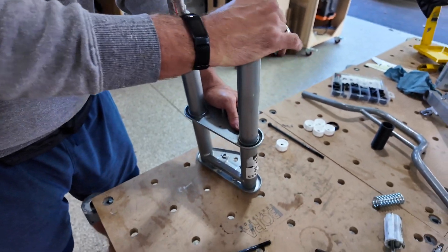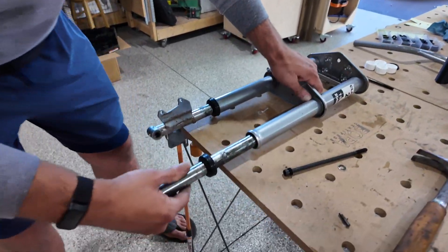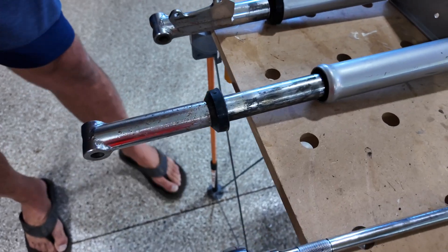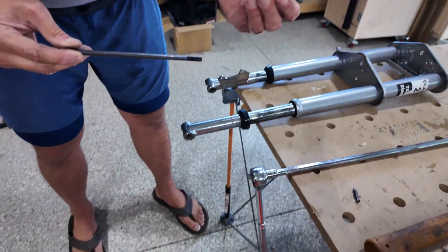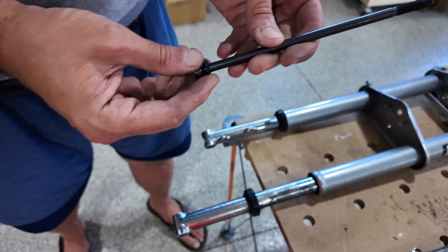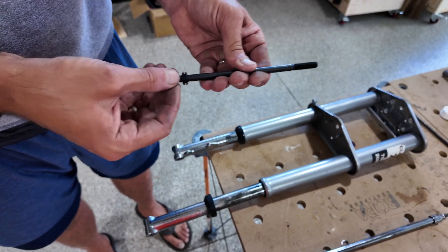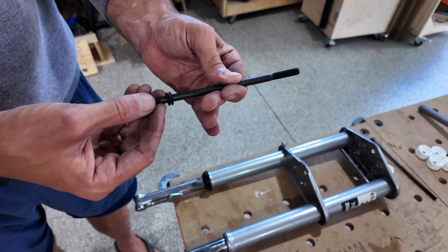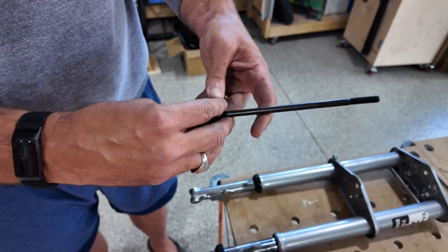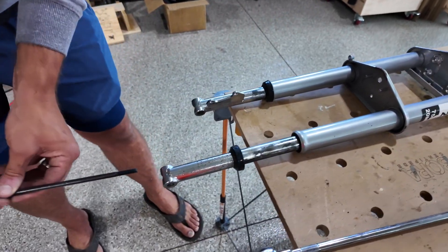Now that the upper fork is loaded, our last step is to put the lower piece in — it should slide right inside and you can already see it's quite a bit longer. We'll compress it slightly as we feed it in. I've added a little rubber grommet to the top of our new, much longer replacement bolt — this is from a generic grommet kit. The only thing this does is soften the metal-on-metal sound. You'll hear people sometimes complain about that on a stock MX650 or any razor bike — as the spring compresses and uncompresses you're slamming into the bolt head. This rubber grommet softens that sound, with the factory washer still underneath.